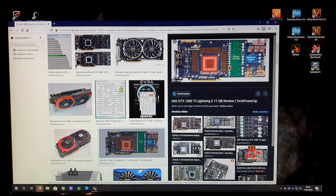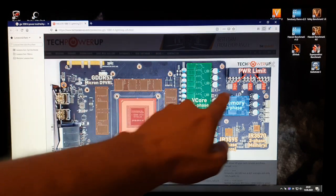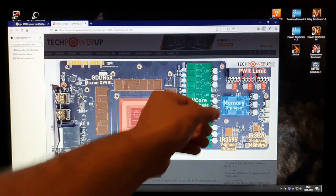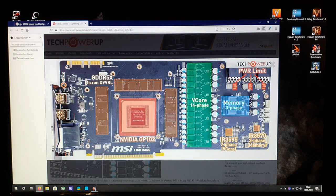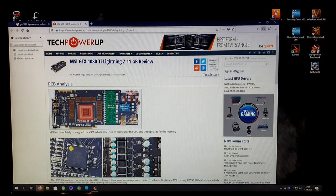I can zoom in so you can see the shunt — they just paint some liquid metal over here as a small bridge. But you're better off getting a cable and soldering it onto this contact to do a small bridge, or take soldering wire with a soldering iron, desolder this part completely out, and then do a small bridge over there. Please guys, do not apply liquid metal here because it will destroy the contact surface.